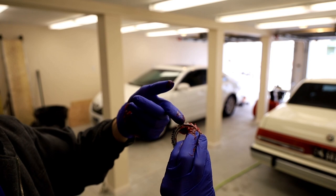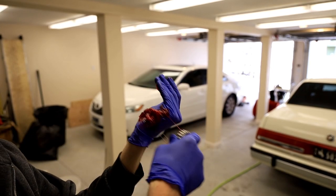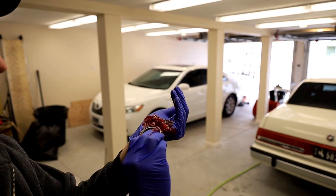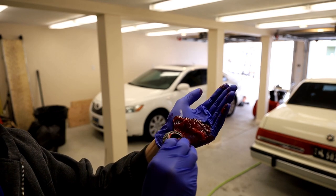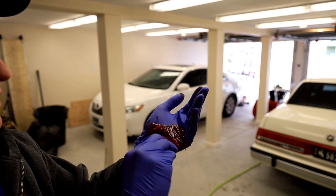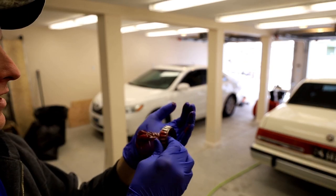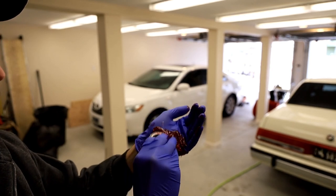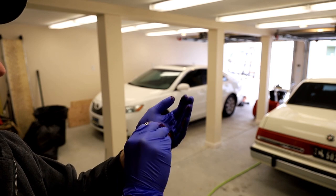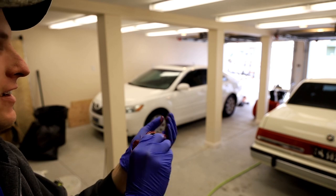And you can see it's coming out all along the top. So I just take that stuff from the middle, rewipe it, recycle it. Oh dear, it's going on the floor, of course. You gotta make like 8 messes too, by the way, when you're doing this. So you just keep doing this. If you don't do this, again, I cannot overemphasize that enough. The bearing is not gonna last, folks. You're gonna be the dude with the wheel that fell off the trailer and trashed the spindle, the bearing caught fire, or something nasty like that.